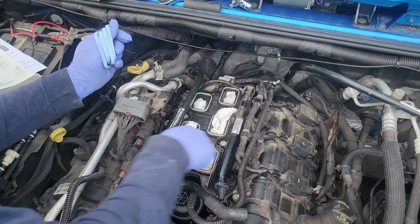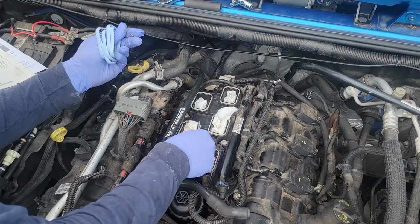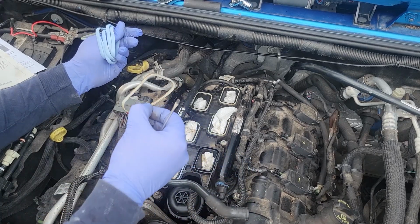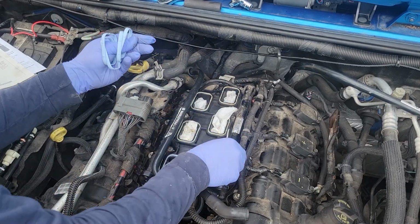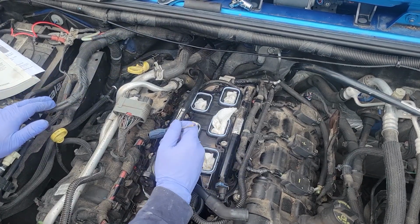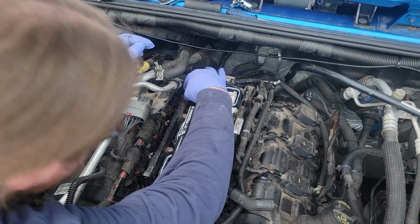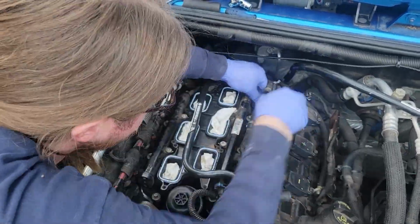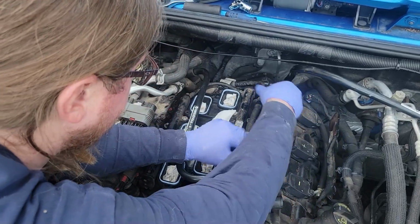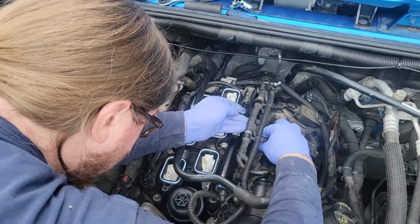Pull these seals out and put the new seals in. Now these ones don't have that flat bottom like the other ones had, which is probably a good thing because these seals are probably original. Seals are done. I'm gonna go through and plug in all these injectors. Okay, make sure Christmas trees are back in their little areas. Perfect.